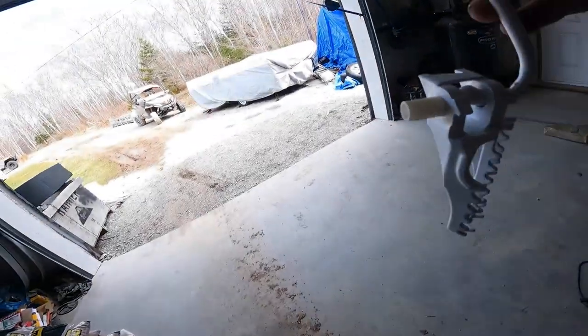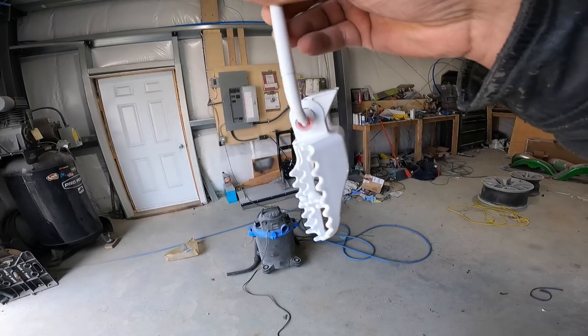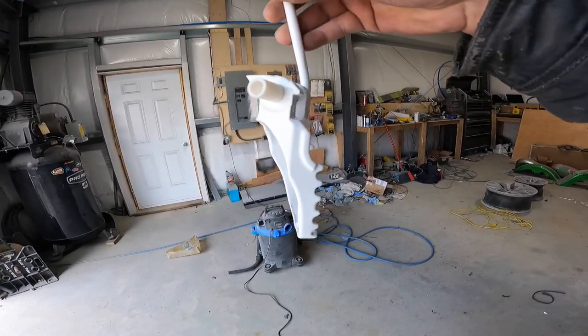Here they are, all set and ready to go. They were done white. I've got the silicone plugs in there to keep the pivot points from getting too full and not going together properly. I'll be doing the same with plugs for the threaded holes on the frame itself. So we're gonna get ready to throw it in the oven, outgas it, prime it, coat it, and get it done for the customer.